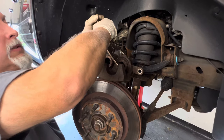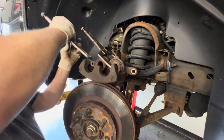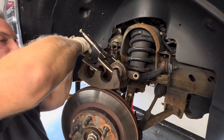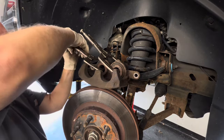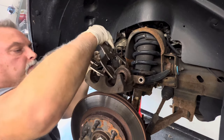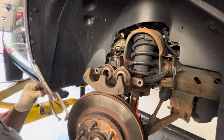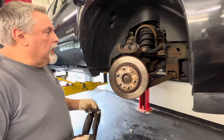Let's go over and collapse the rest of our caliper piston. We're going to squeeze this caliper piston down slowly and work them together. Sometimes you can use your pry bar to collapse it a little bit. These are a little more difficult, so I go in and collapse this one first, then finish by collapsing this one and tighten it up. Some guys use a C-clamp with the old brake pad. Now we're going to put caliper pin lube all around here and make sure that these boots stay lubricated so we don't have any issues with them. The caliper is collapsed and it's all lubed up.